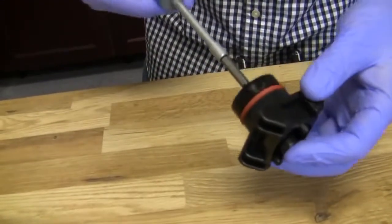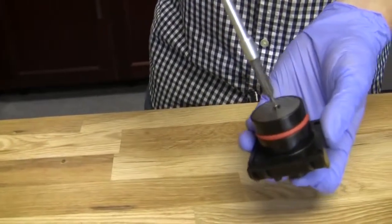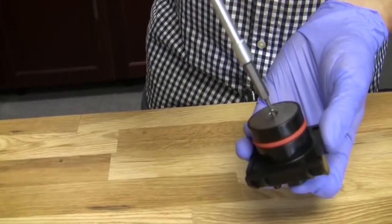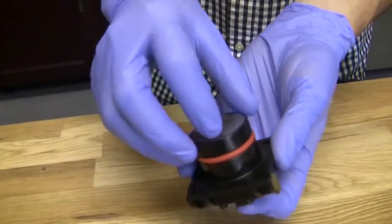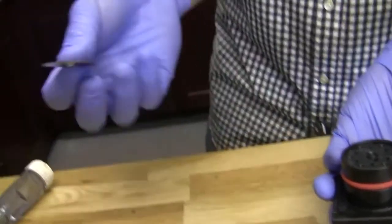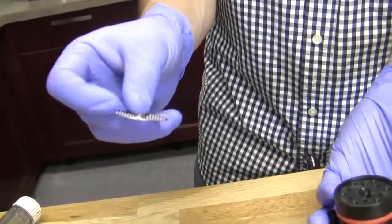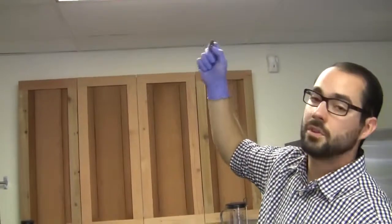There might be some really short Torx 10 out there, but this way you can really see everything going on in here. The other thing is, it's not just the screen that gets dirty — it's also the other side of it. So there's our screen. This is a brand new brew unit so it isn't that dirty, but a good way to check is to always hold your screen up to the light and you can see all the holes individually. If you've been using your brew unit a lot, a lot of them will be clogged, and you just need to soak them in some sort of cleaner and take care of it that way.